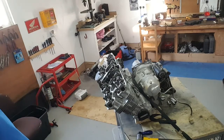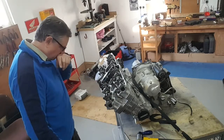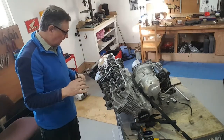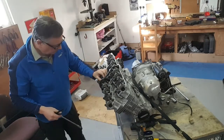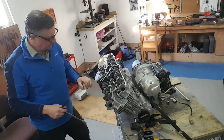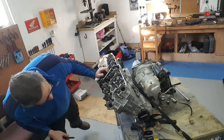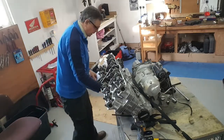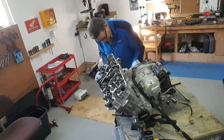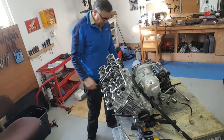Yes, that isn't a pleasant sight. Anyway, we're inside now, so basically the next thing we're going to do is start pulling this head apart. One of the problems I may have is actually getting these camshafts out, because the engine may or may not rotate — we'll find that in a little while. I'm just going to remove the end cam cap cover. More RTV. Whoever did this must have had shares in the RTV company.